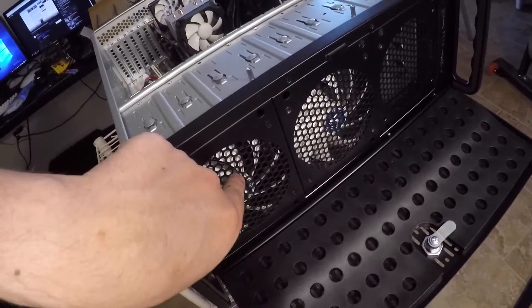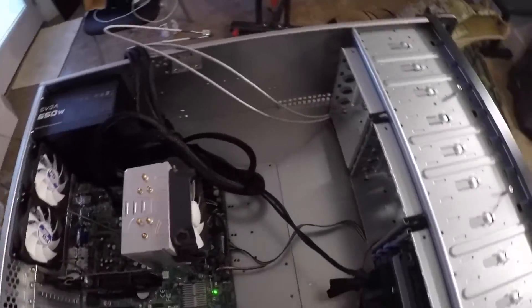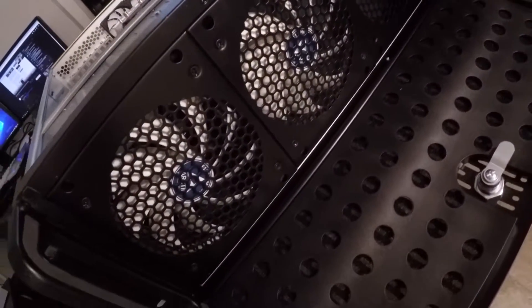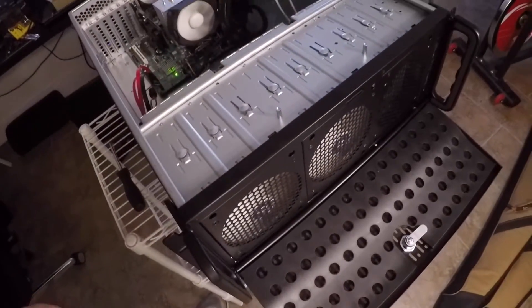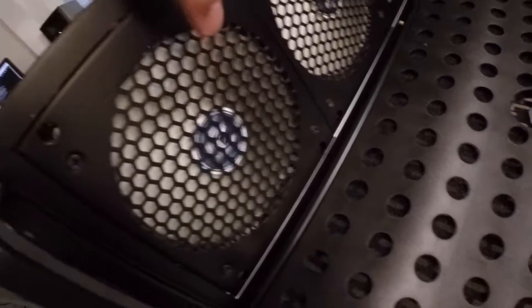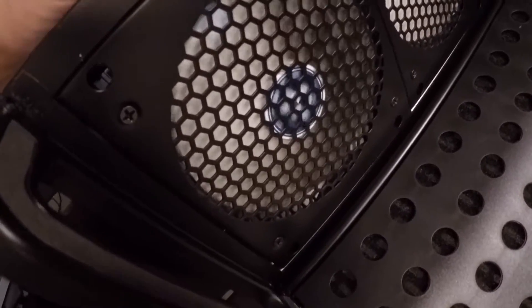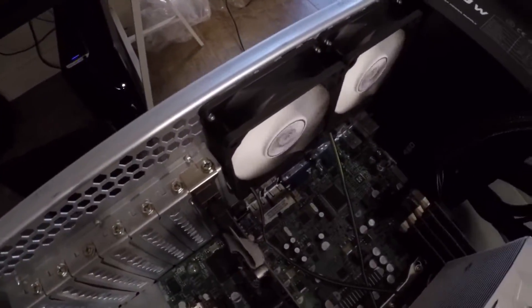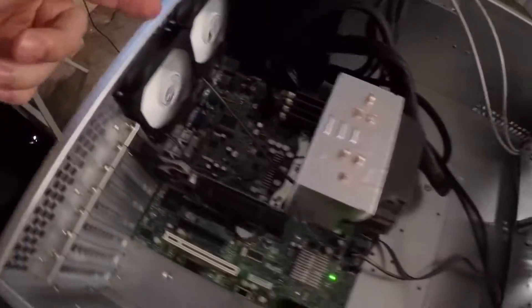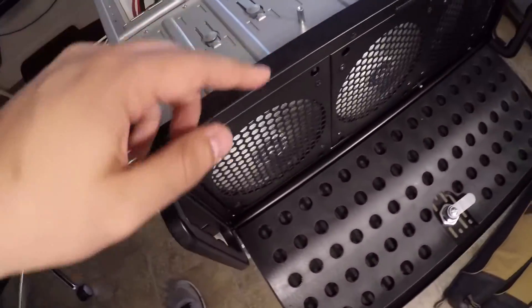I put two fans up here and I wanted to show you why I don't like fans in this position. I'll turn it on — you'll notice it's extremely noisy. That's because the fan is right up against the grill, and when you have negative pressure right up against the grill it causes a lot more noise than when the intake side isn't blocked. These are 92mm and those are 80s, so they're different fans and will sound differently, but the grill proximity is the main issue.